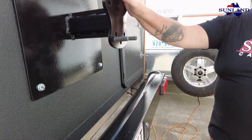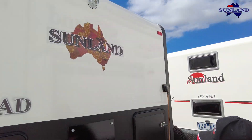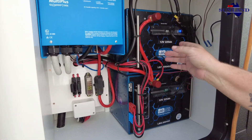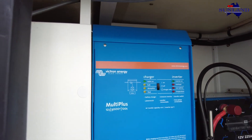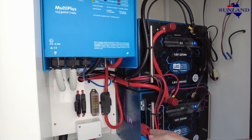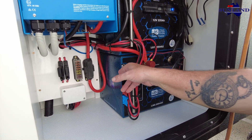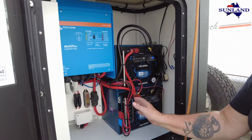They've added an additional spare bracket on the van for their car, and they've got the camera at the back. They've gone for the large power system which includes 225-watt solar panels, 450 amp hours of battery power, and the 3000-watt inverter. They've got input from the car via an Anderson connection, input from the solar, an input available for an additional outside blanket, and also a 50-amp output if you want to run something directly off your battery.